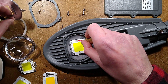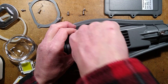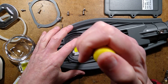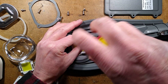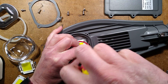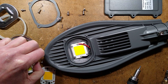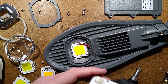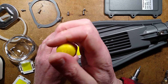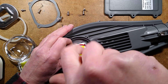Let's actually lift this out. I like the way they've put a bit of strain relief silicone on there - that's actually insulation under the metal cover. I may need a better screwdriver for these screws. Will there be heat sink compound under this? In another of these videos I did change the LED to a purple grow-light type LED just because I could. I don't think the flip chip LED is going to fit in there, unless the 50 watt light is physically bigger - but I don't think it will be. Maybe I can get one of these in an ultraviolet version instead.